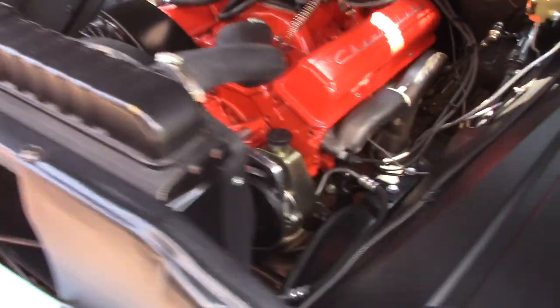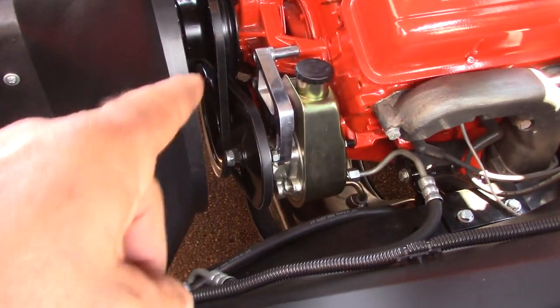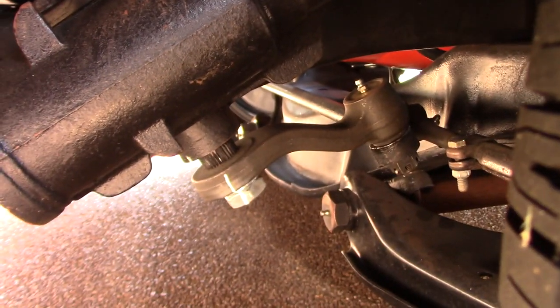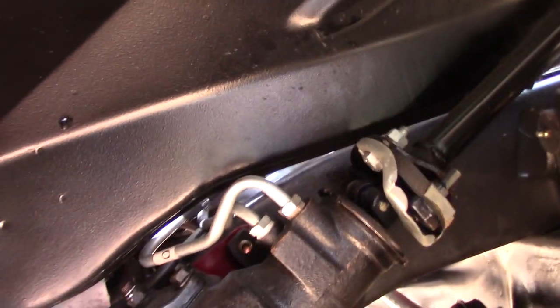Unlike the big back window on my red pickup. I went on and put power steering on it a couple of months ago. A power steering pump my buddy gave me. Got the bracket and everything, got it all hooked up. Had to put a different pitman arm on it that comes down. There's the box. Cut about two inches off of the steering rod coming down. Welded it all back in. It does real good.